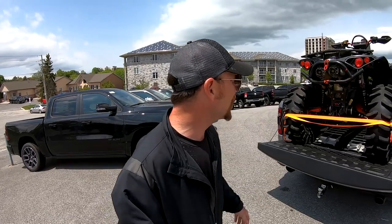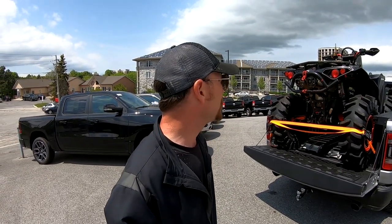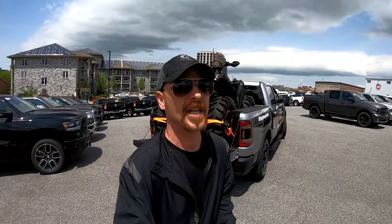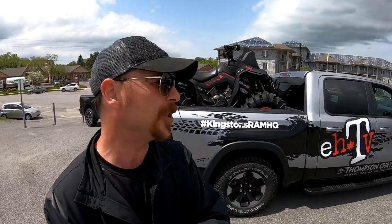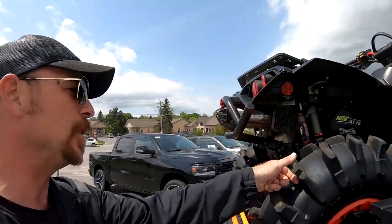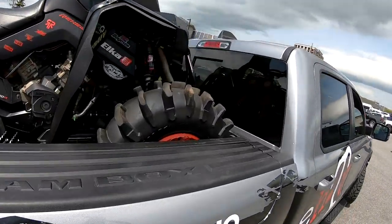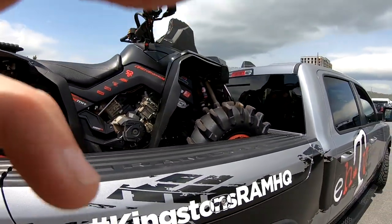I'll take it into the shop - easier to work on it there with carts. Tires - I love the XM310s. We took them out in the Skag and they rip, they work awesome. They kind of float, they're wide enough and with that straight-cut paddle they clear so darn good. Only downside is they're quite a soft compound - after three or four rides I'm starting to round them off pretty good. No major lugs missing but they've taken a beating. Time to rotate those to the front - the fronts still have nice crisp edges after four or five rides.